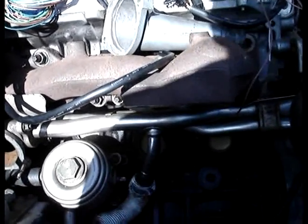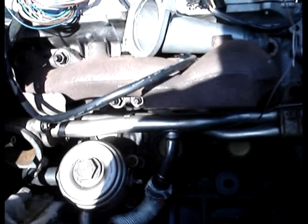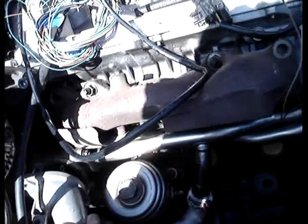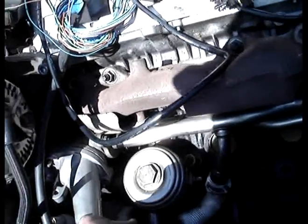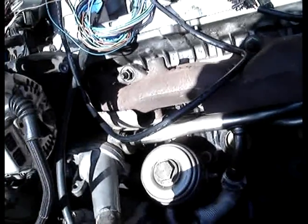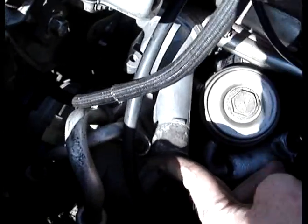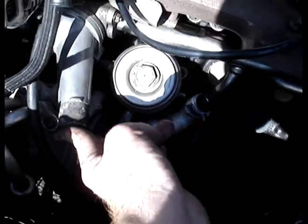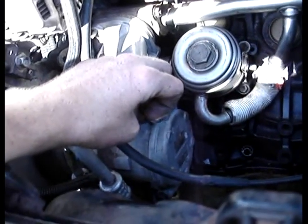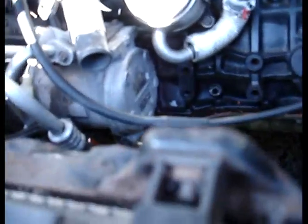So it's going to be a little bit longer before I get this thing connected. I also can't put my thermostat housing together yet because of clearance issues. And this is the stock 5S-FE compressor, which means I'm going to have to take it out and get a compressor from the GT4, or just run without a compressor if I can find the compressor bypass pulley on a bracket.